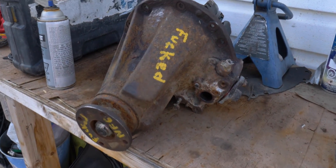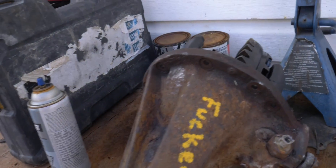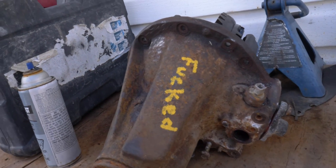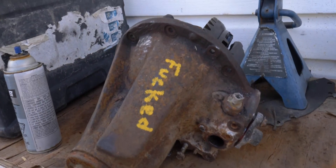What's going on guys, today we are back. I went to Nelson the other day and picked up an e-locker. Now this e-locker does not have an actuator, but we got that from the auto wrecker. The front end is getting an e-locker — that is the plan. The plan is to take the 456s out of my truck and put them in this third, because the V6 thirds work perfectly fine in the e-locker housing.